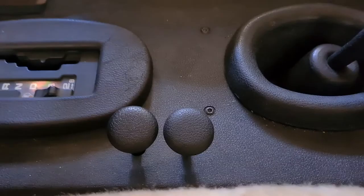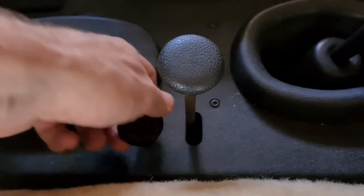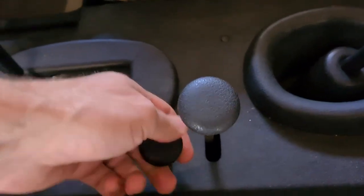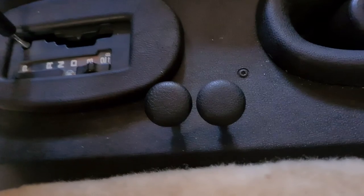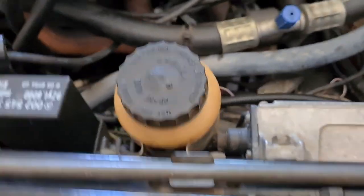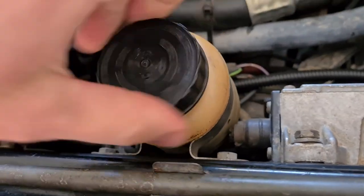This is a video on how I changed the front master differential lock on our 460 G-wagon. We've had this vehicle since 1985. The rear locker was working but the front would not lift — it was like it was hydraulically jammed or seized. There's our fluid reservoir in the engine bay on the left side, which receives conventional brake fluid.